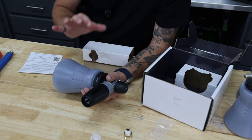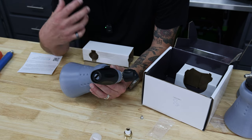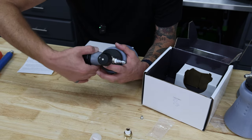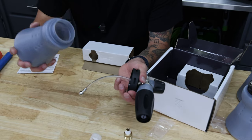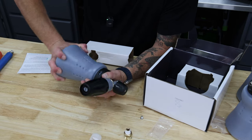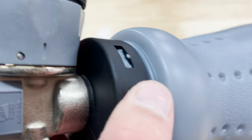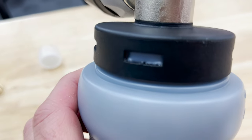Now, the MTM's head unit is great — Italian precision engineering. The head unit sounds very fluid when you're using it, the turn is always really nice, and you can feel it actually seat in right there. This piece is really, really nice. The bottle, on the other hand, just doesn't feel like the same precision engineering as the rest. On the brand new one, you can see the tabs are chunky and definitely not as proper as they should be — there's excess material on them for sure. We're working it back and forth to wear it down, and you can see excess pieces of that tab coming off. I filed that piece off and now it's functioning a lot better.